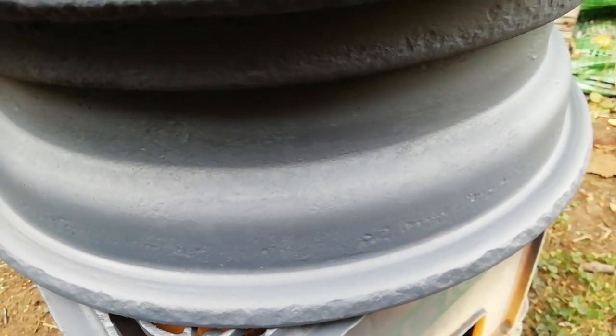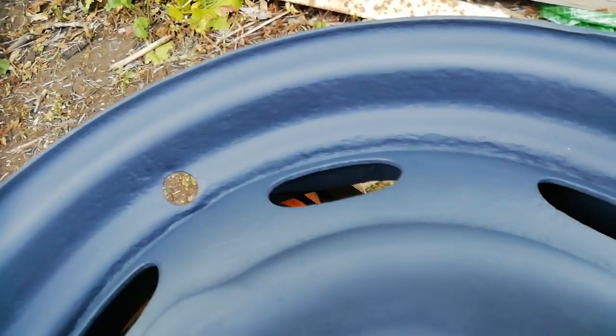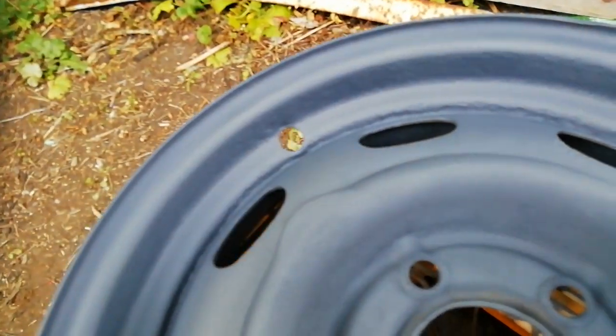This is the rather rough one. I can see this being an issue. I may well have to fit an inner tube with this wheel, because the sealing surfaces are rather rough. Got away with it on the valve hole, just about, but it'll need a ferrule again because the hole's rather big. We'll see how we go. Hopefully I can get another 3 of the slightly wider wheels.